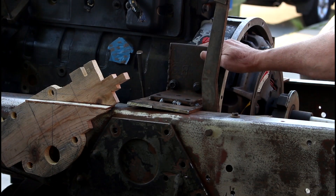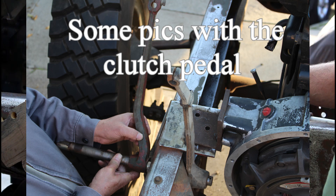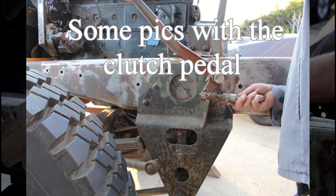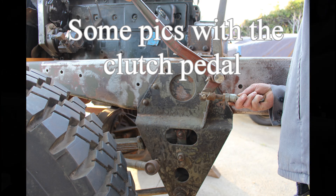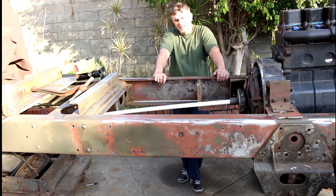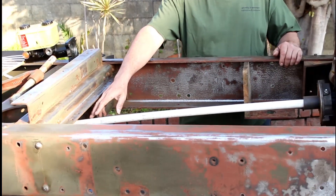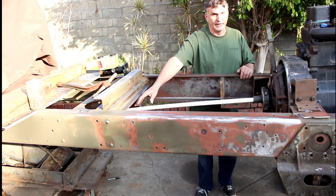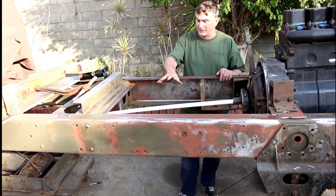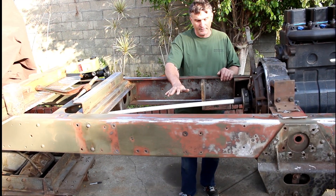Also when we go to the other side I'm going to show you that we've got a slight slope problem, and that's also going to be taken into consideration when we do the mount. As you can see by my very precise piece of plastic tubing here, we're going to run into a little bit of a problem by the time we get to our transfer case. It's cheesy but it does help to place things, so that's why we're going to go down more on the backside.